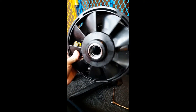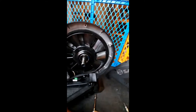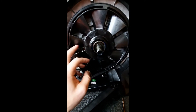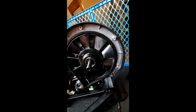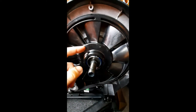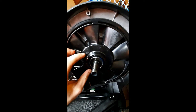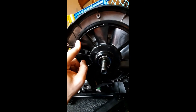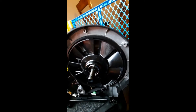They sent me a fan pulley and a screw — it's an Allen head now, but the original was a Phillips. I loosened everything up, took the belt off, and the old pulley had some play in it. I installed the new one with some Loctite retaining compound on it to prevent premature wear on the cast aluminum shaft. But the new pulley had the exact same amount of play as the old one.